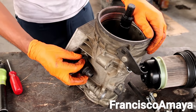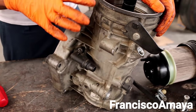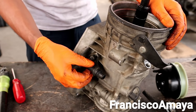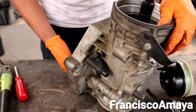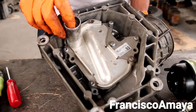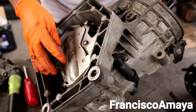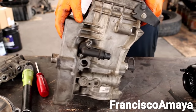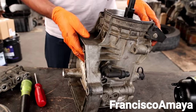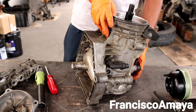We have the coolant line for the older ones. For the newer trucks, from 2017 on, you won't have this coolant line because they don't have a cooler in this area anymore. The pipe is right here but doesn't do anything because there is no cooler — this area is completely sealed, no water going in. So that means there is no cooler and this is completely off for the newer ones.